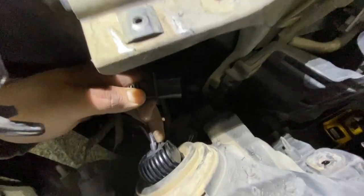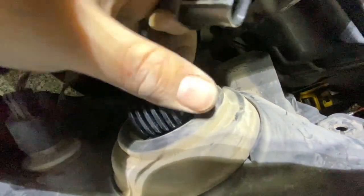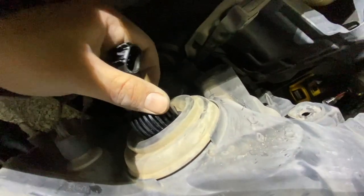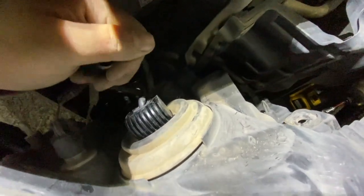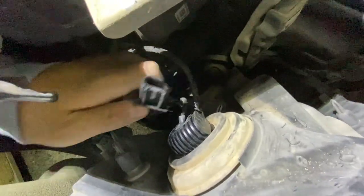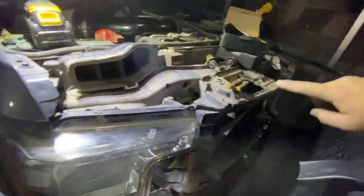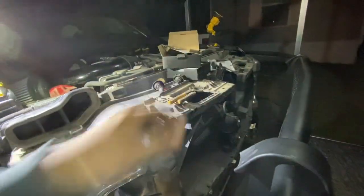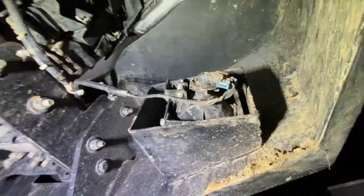For the high beams and low beams, take the LEDs from the kit — it's a Texas truck so it's got dust everywhere — put it into the socket and turn clockwise. It may take a lot of elbow grease because these are going to be really snug, so don't be discouraged. Push in as hard as you can and turn clockwise until it hits a stopping point, then plug into the harness. After the bulbs are in, put back the 10mm bolt and then the two that go in the corners. Repeat this on the other side.